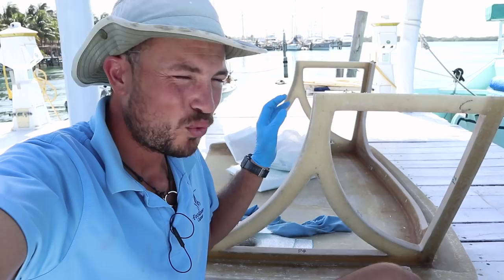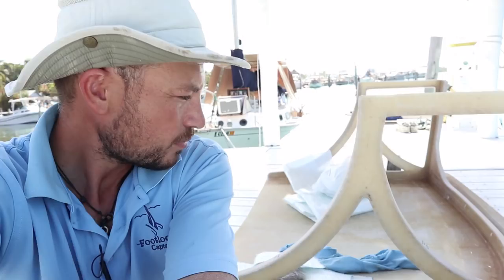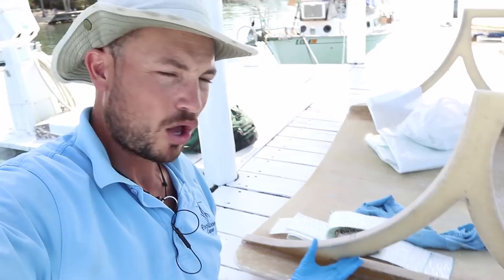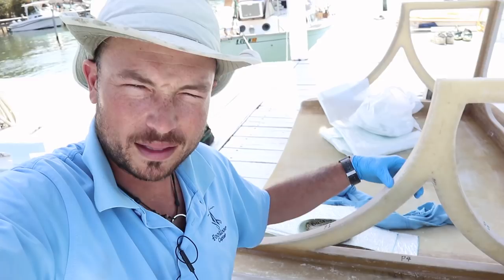We are coming up to the final stage of creating the structure of the hardtop. So I've cut out all of my fiberglass for this side. I'm gonna try and go with one piece of glass per edge, right? So one piece of glass here wrapping around on either side of the frame, one piece of glass under here wrapping around. So what that'll do is that'll double up. So I'll make two more layers of glass on the sides of the frames, and then here on the edges, that'll be one layer.